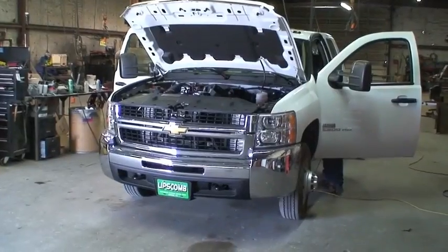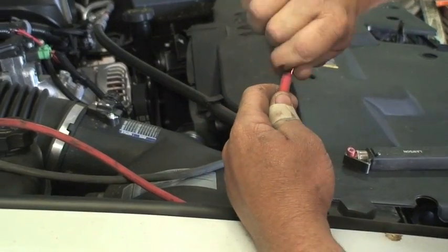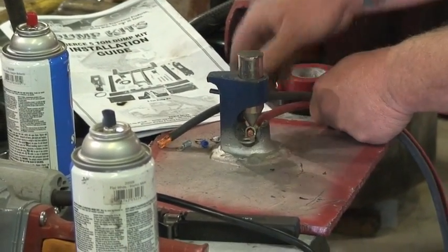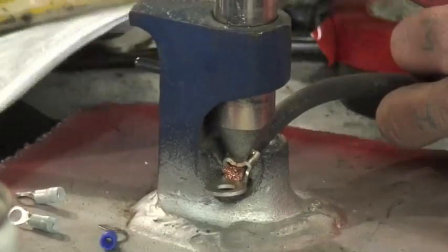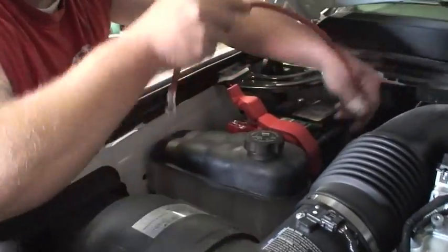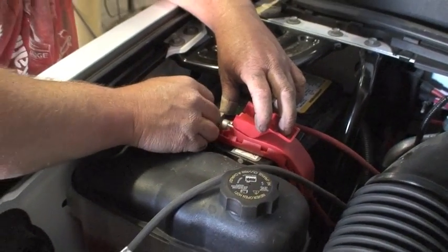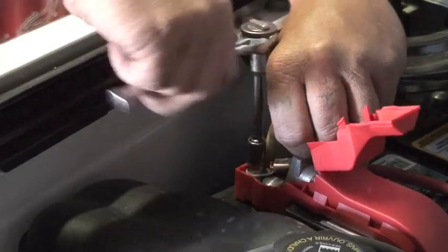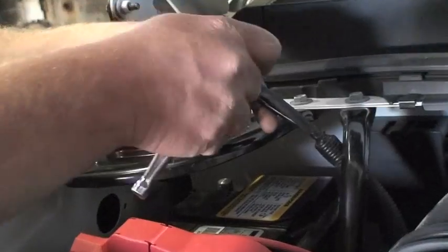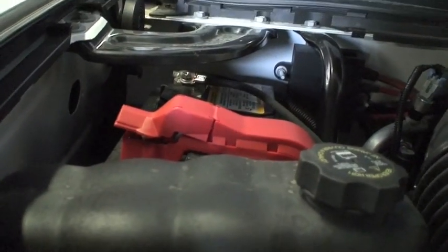The last step in the wiring process is to run the positive and negative cables to supply power to the pump directly to the battery. We run the cables directly to the battery post rather than to any existing vehicle wiring. Crimp the end onto the welding cable using a crimper, or they can be crimped with a hammer and chisel or a hammer and a punch. To ensure proper ground, we always ground our pump units directly to the battery using number four welding lead for both positive and negative — both are supplied with the kit. It's very important to secure the battery cables at least every 12 to 15 inches, because driving down the road these cables get blown by wind and can wear through the insulation.